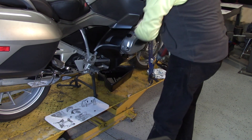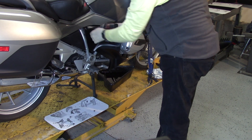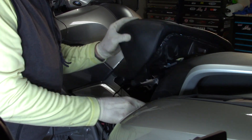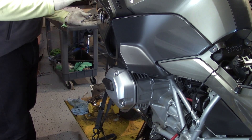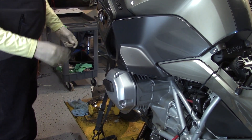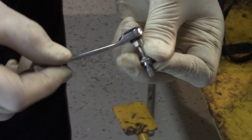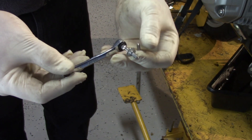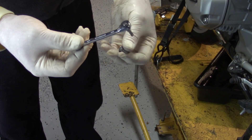Now we're going to continue working on the right-hand side, taking off the panels and working our way all the way up to get to the air filter box by the fuel filler neck. To remove the front side fairing, there are a lot of screws up underneath this one. Here's the quarter-inch ratchet drive that allows you to work in the confined space up underneath the front fairings where the front wheel is in the way and you can't use a driver drill.